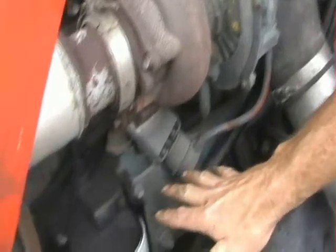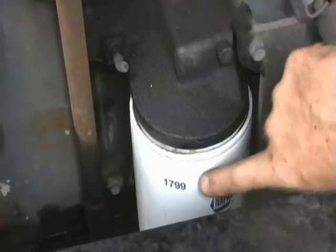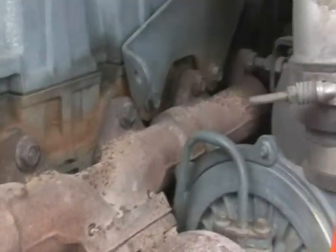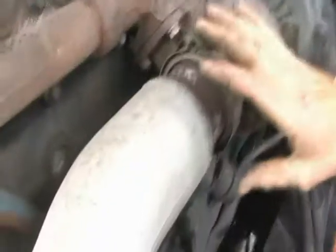On the right side of the engine you'll see the main oil filter, which gets changed frequently — you can see how new it looks. This is the exhaust manifold; make sure all the bolts are in place with none missing. Check the valve cover seals as well. From the hot section of the turbo, the exhaust gases leave the truck through the exhaust system, so we're looking for any damage to the exhaust system as it travels back below the frame rail.